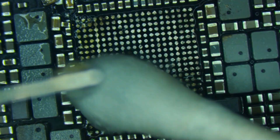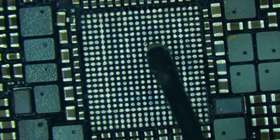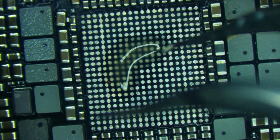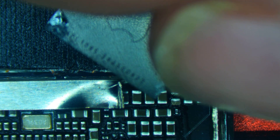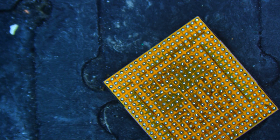All right, time to clean up — adding some isopropyl alcohol to clean up all of the flux, then clean it off nicely. Going back to add some flux, heating it up and moving it around getting it nice and thin everywhere. The chip we pulled is the 343S00422, and here we've got our new chip — also the 343S00422. Let's take a look at it and make sure we're happy with the solder balls. There are a few chips I will reball, but this isn't one of them because I like the temperature of the factory solder for this component.